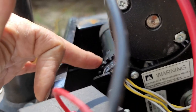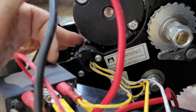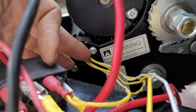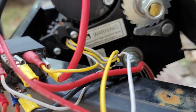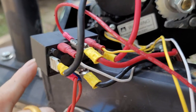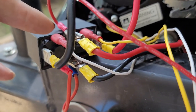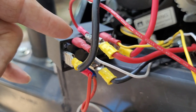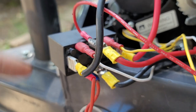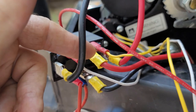So like your switch wire — this is not all original. The yellow and the white go to that sensor that stops your roof from going up or down too far; all that still works. You see the yellow and white wires? That runs into that. So basically you're going from your switch into that, and then from that to your solenoid, and you're going to just keep it like it is. That white and yellow wire will plug into the top — common one, common two.